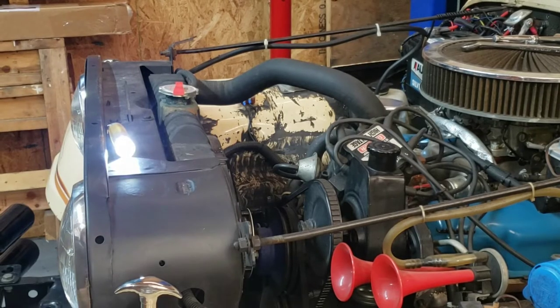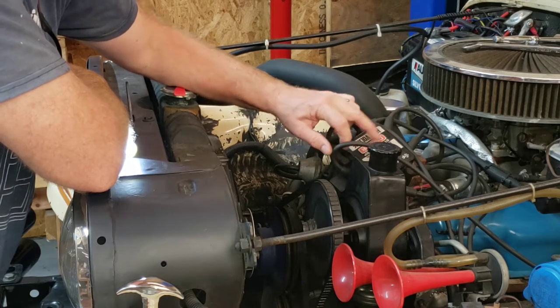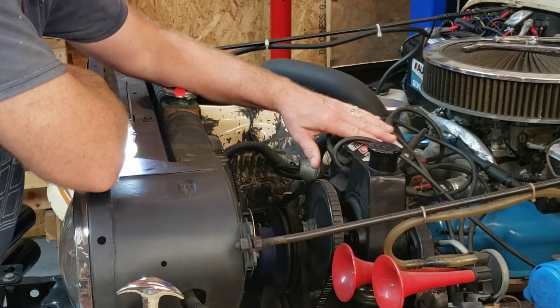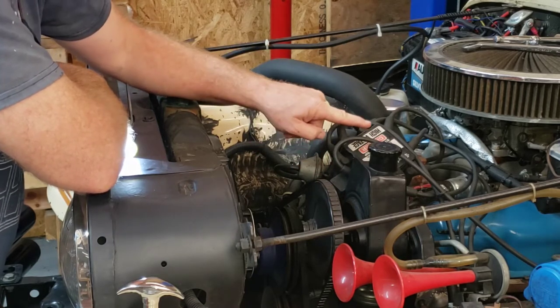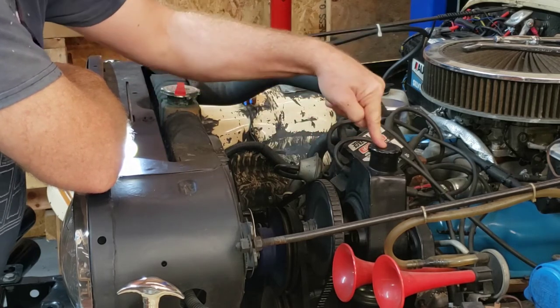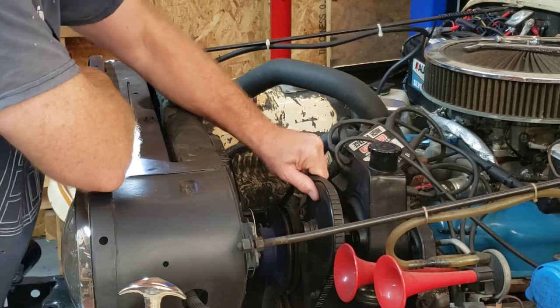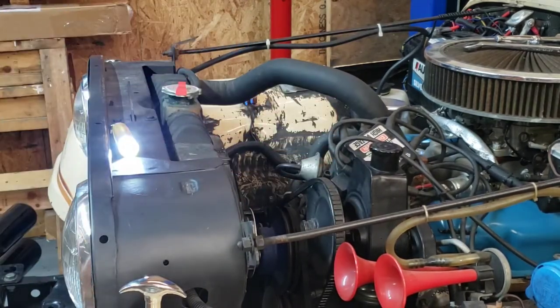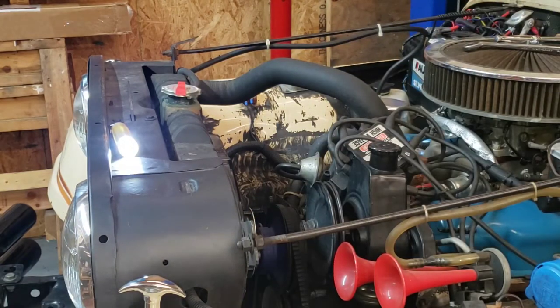The funny thing about this old CJ is this is an aftermarket electronic ignition distributor from DUI — Davis Unified Ignition. It's a really fine product. However, it was never intended to be used on this engine in a stock configuration. The wiring harness connector for the DUI electronic ignition butts up against the power steering module. When the belt is tight there's no issue — plenty of clearance — but when you want to remove the belt, it bumps up against the distributor. It's really kind of annoying. In the past I believe I actually loosened the distributor to do this job, but I'm going to see if I can do it without going that far today. Just a little gentle persuasion — you don't want to break your distributor, obviously.